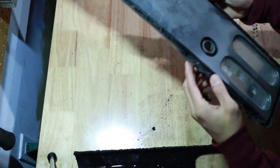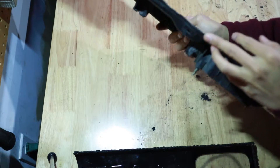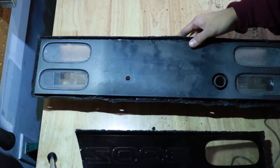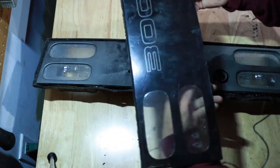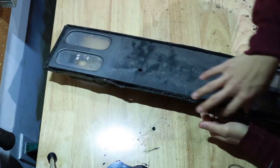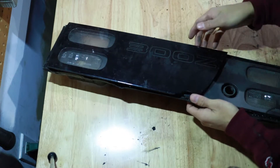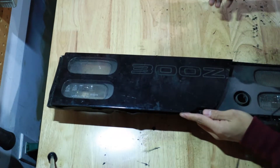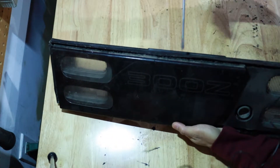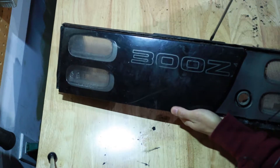As you can see, when I used the heat gun I damaged the casing a lot — you can see a lot of bends here. This one I actually broke the first time I attempted it, that's why the panel is cracked. So heat up the glue, and if using a heat gun try to heat it evenly, then use a screwdriver to pry it all out carefully.